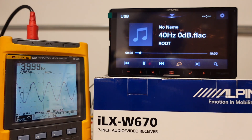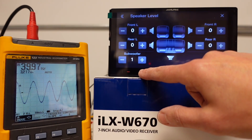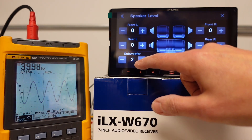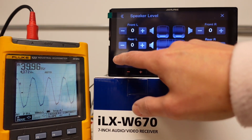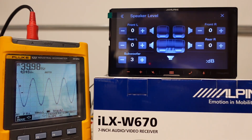My guess is I may need to go in and adjust the speaker level, because that's what clients will do — if they can boost the output, why not? Let's see what happens with plus one — we got a little bit more, still clean though. I'm just so used to Alpine being clean at max volume; we are super clean and I love that. It makes our lives in the install bay tuning much easier. Now we have some clipping. So it looks like we're going to get four volts with our subwoofer at plus three under the speaker level menu, at plus 15 in the subwoofer menu, and that signal is really nice and clean. I'm very happy that Alpine has kept their quality even though this is made in a different facility.